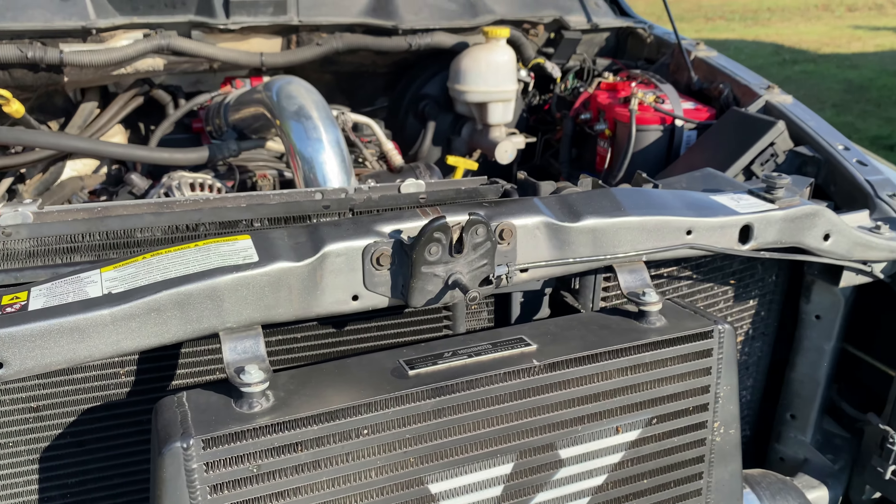All right, that looked good — that looked great! So you saw it, it didn't really get over 11 and a half, which is really good. In the fuel table we have a lot of fuel going in on the table, but now we also have it tuned still for the 17 and a half volts, so down low we're still seeing way too much fuel because of the step-up plug — it's definitely getting a little more fuel, so it's a little rich. But we'll tune that out — that plug is doing what it is supposed to do.